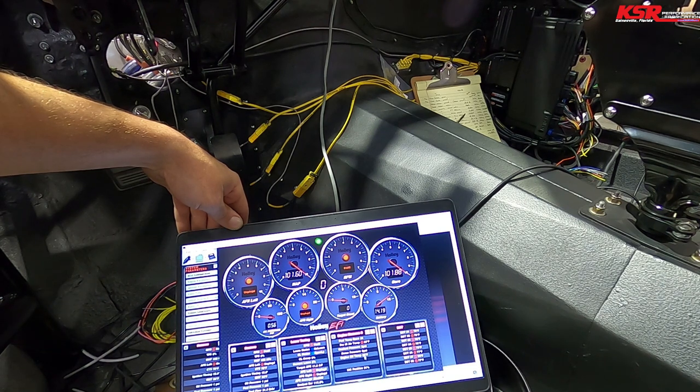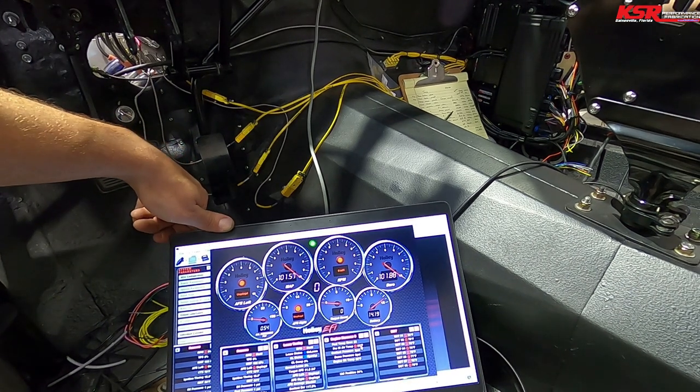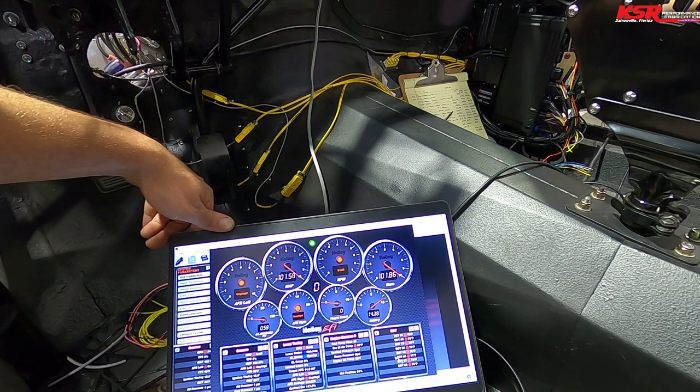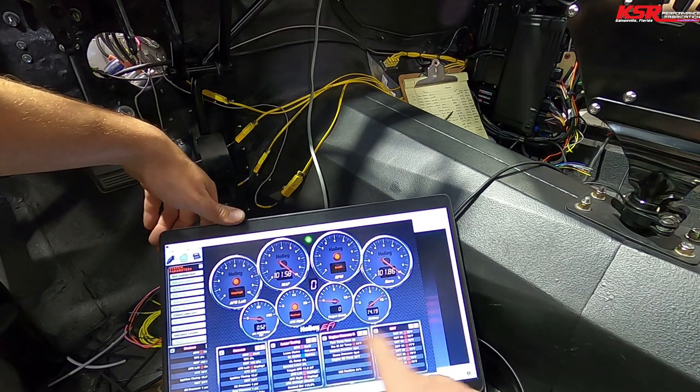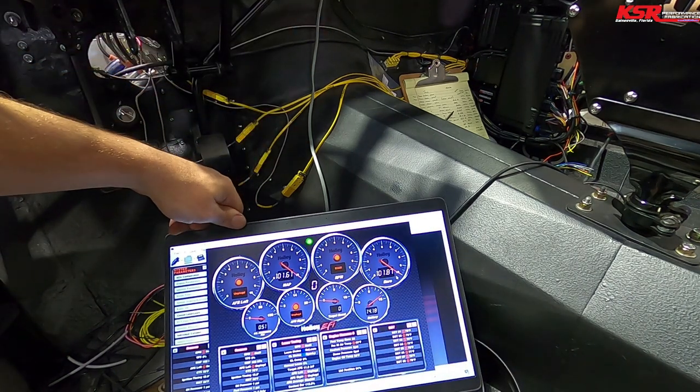So those should all be reading around 77, 78. You see coolant temp is 76. Whenever you're adding multiple sensors that kind of monitor the same thing, verify that they're all reading about the same. So you can see the barrow circuit is the barometric pressure sensor in the ECU itself. So offset your map sensors until they're reading really close. So we're 101.6-ish, and this is 101.8 and a half, almost 0.9. So I'll go back and trim those a little bit more.